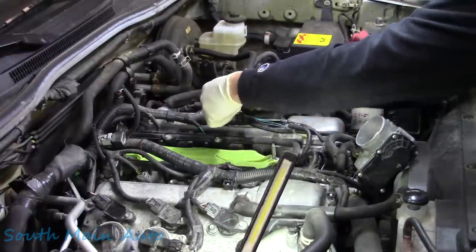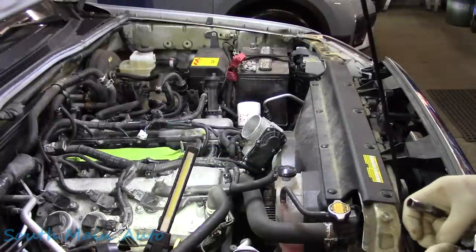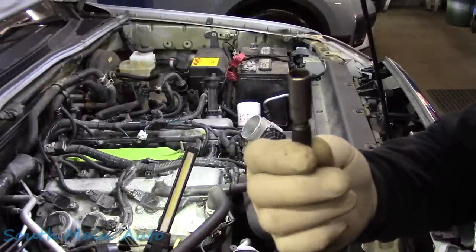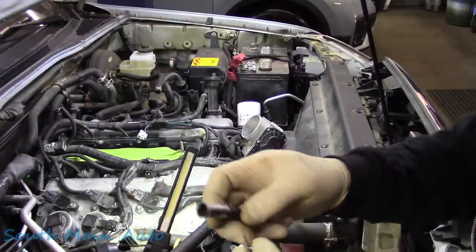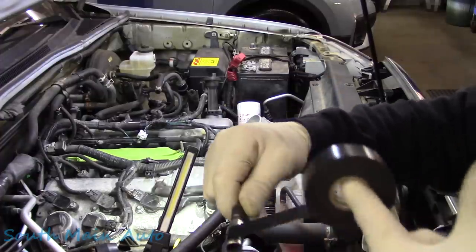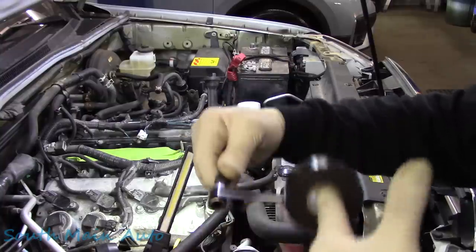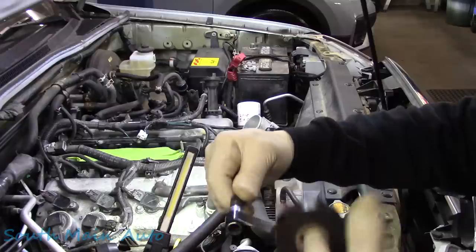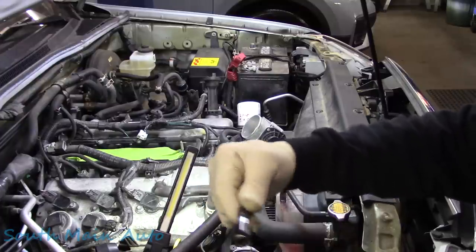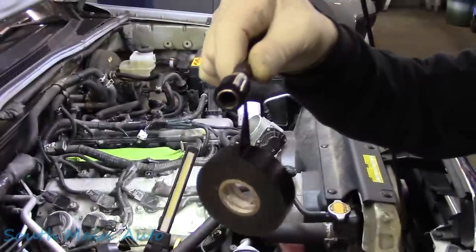Should have made a mini roll. Now we got to cut it. The mention of the mini roll, but I got a better one to show you. You take the 10 mil quarter inch drive, if you can find it, and stick it on an extension so you can hold it. Take the Super 88, bring it around however many times you think you need. And when you hit that many times, go about four more times, or six, and then chop it off, okay?